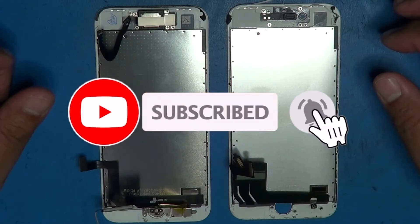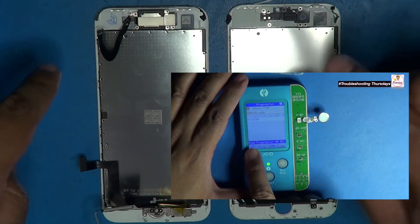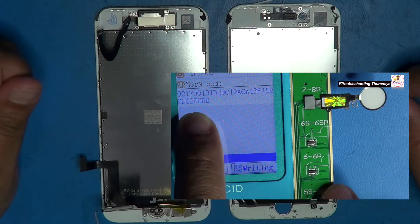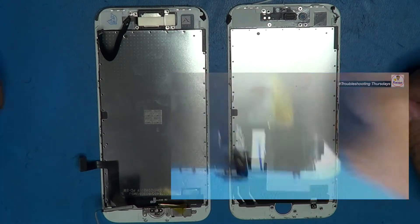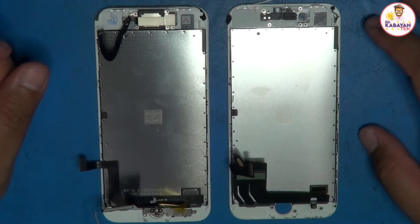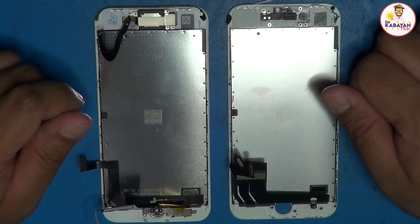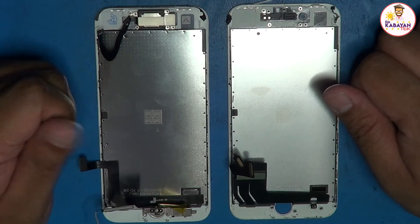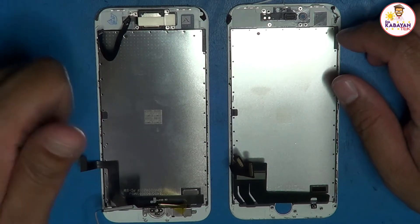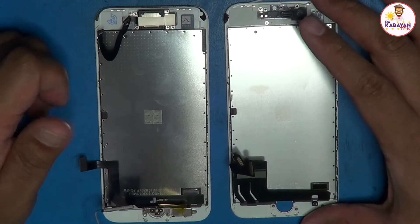As per my experience, on the video I posted — the link is below — I bought a JC home button, copied the serial number of the original home button, and put it on using the JC V1S. The only thing I noticed is that the button is a little bit finicky, meaning there are times it will just press by itself. The button will work when you press it — it goes to the home screen — but the only thing that would not work is the Touch ID.